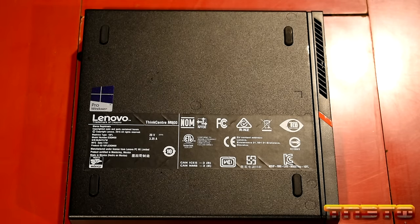If you're not going to use this, if you don't plan on remotely controlling these units over IP, kind of like an IPMI, disable it, okay? So you want to fully disable it. Or you can also put in a CPU that doesn't support vPro, okay? But stay tuned. I will be making a video on Intel vPro and AMT. You'll want to know about it. If you have a unit that has a sticker that says vPro enabled, you're going to want to know what that is, okay? Because it can be a big security hole if you don't know what it is and you don't configure it properly, okay? So we'll go ahead and set that like that.